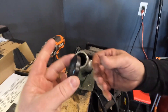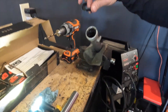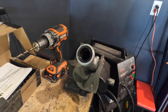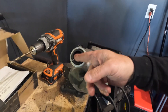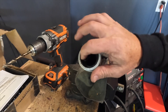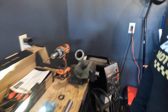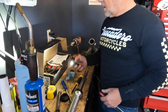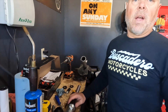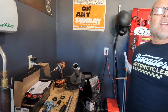This is what a regular seal looks like, and it fits in there beautifully. But this one came with like a two-part piece where we got the normal seal out, but now there's some inner rubber thing — that's the old dead leaky one. I've got to get this inner thing out without wrecking the fork leg. If we can get that out, we should be able to just put the new seal in, put these together, and everything should be good. Worst case scenario, we screw these forks up so bad we'll just buy new lowers.